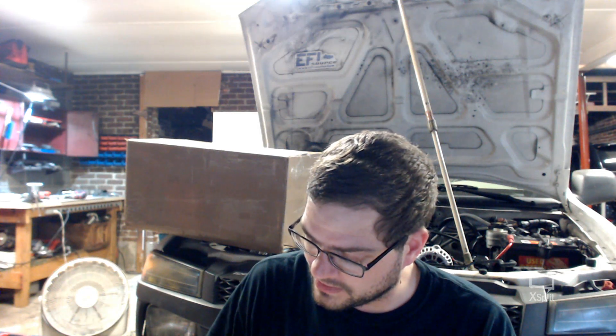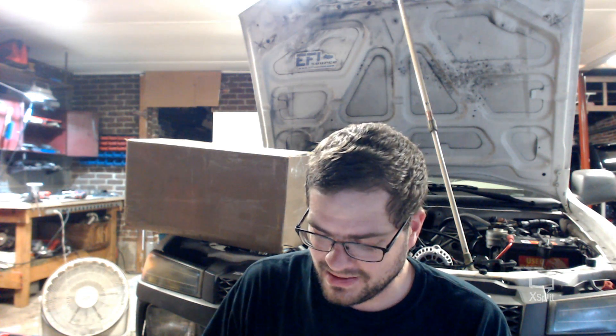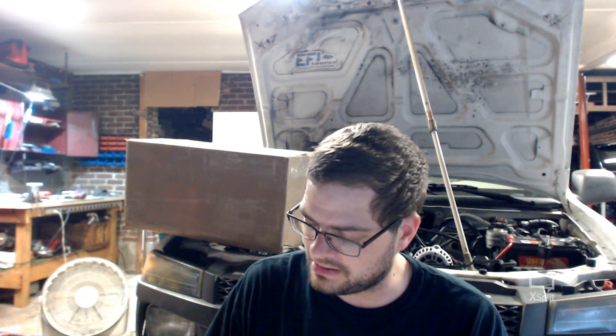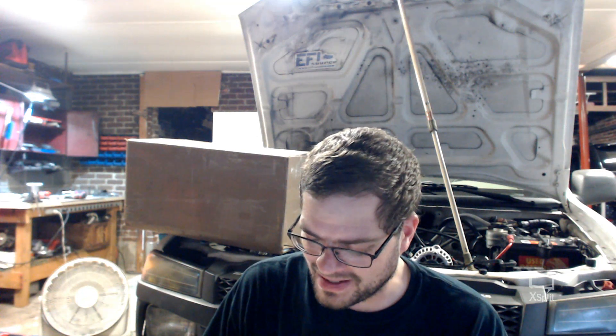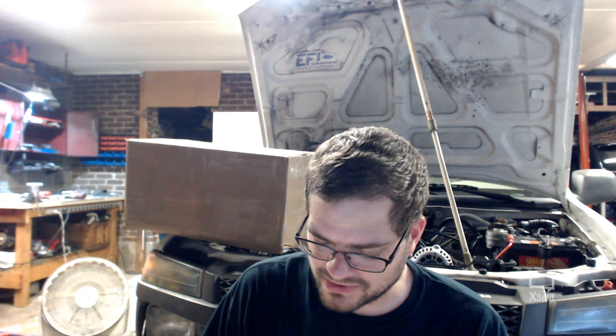Reading the letter: 'Dear Matt and Jamie, congratulations on the little boy — I can't wait for the sloppy parenting videos. After seeing you put the blow valve in your truck, refusing to let fan mail go to waste, I knew I had to send you something you haven't previously used. Behold the PMass HPX — this bad boy will support around 1,200 crank horsepower in a three-inch tube and can be used in a tube up to five inches. Included is a flange for your buddy to weld on, a conversion pigtail for you to hack up, and a transfer function sheet to copy directly into HP Tuners. Tuning with a proper MAF is a cakewalk, and the data provided with our custom calibrated sensors makes this even easier.'